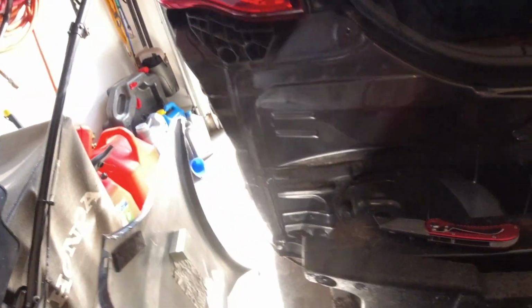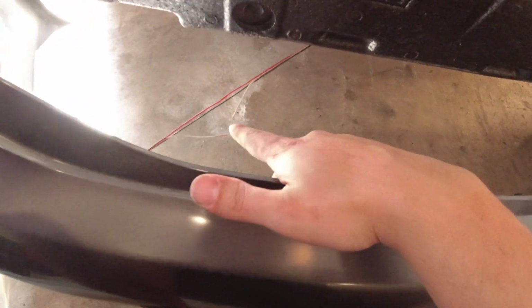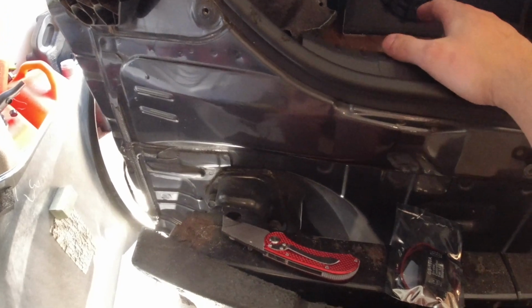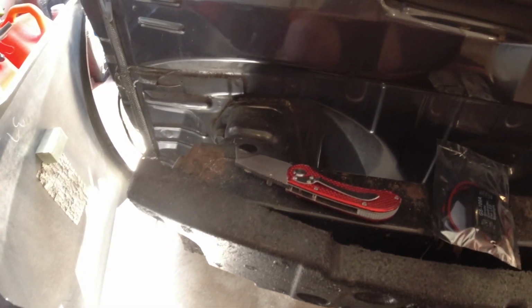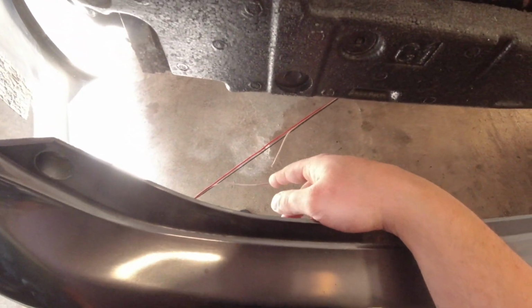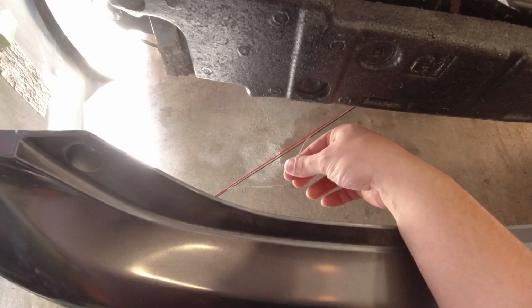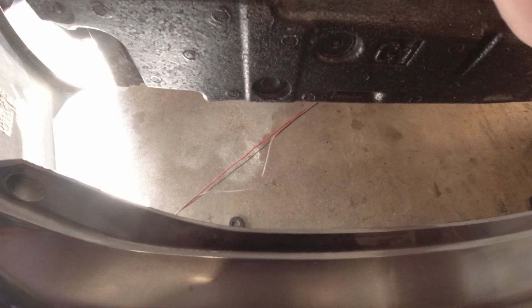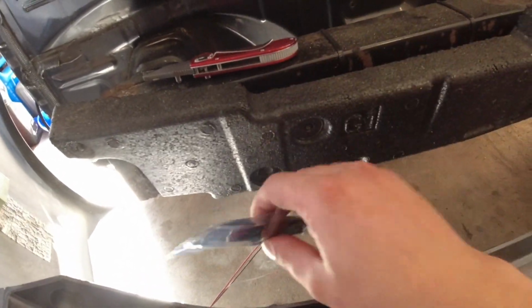All right, so after actually doing a little bit more testing, I went to cut the white wire to see what light was actually running. And my white wire is my constant wire, so I'm actually going to have to solder this back. But now my brake wire is the red one and my ground is the black one. Like I said, I went to test it and I thought I had it right, but then I ended up shorting out the fuse with the voltmeter. So I just went and cut it to see exactly what it was. This is my constant running, and my red one is my brake light. So the wire colors are actually going to match this. Ignore what I was saying earlier when you tap these in.